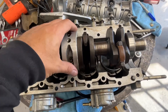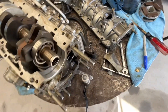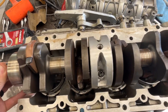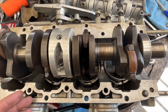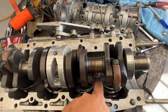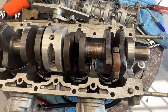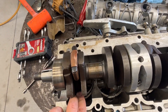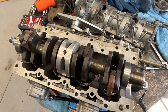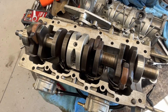So this started out as a reed valve job. Just to point out — you can totally do this without pulling the crank out. I wanted to do an inspection so the whole thing came out. But just so you know, if you pull the crank out high enough to clear the pin down here, and the piston skirt isn't too high, you can get it to about that level and remove each one of these reed valve blocks independently without having to take the crank out. That saves you a whole bunch of time compressing rings and getting everything back in place.